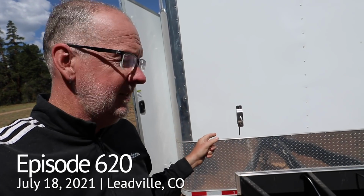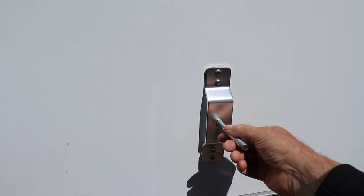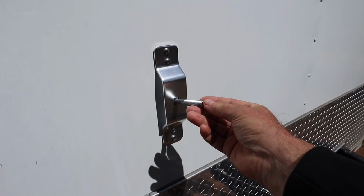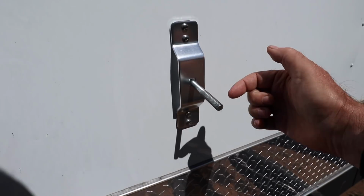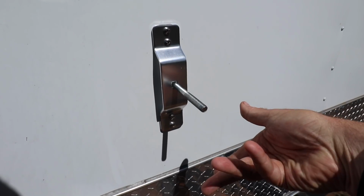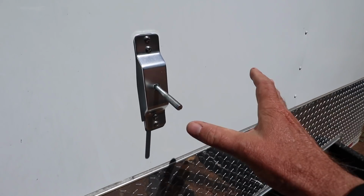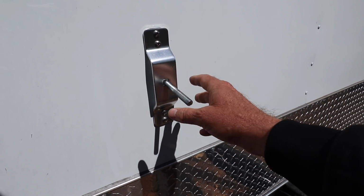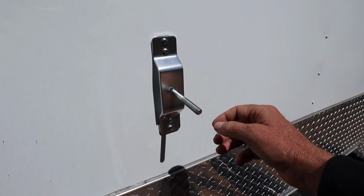Over here behind me you can see where there's a spare tire mount that was put on here, I don't know, 5 or 6 weeks ago by a friend who helped me out, but there's a problem with it. Let me show you. You can see this bolt here that goes out and this goes through one of the lug nut holes on the spare tire. Unfortunately, this distance here is about 1 inch short of the distance I need for the spare tire. It doesn't matter if I flip it one way or flip it the other, it won't get on here, and it is quite an ordeal to lift this spare tire up here by myself to try to get it mounted on here. And then I finally determined that this is actually too short. It needs to be about 1 inch longer.